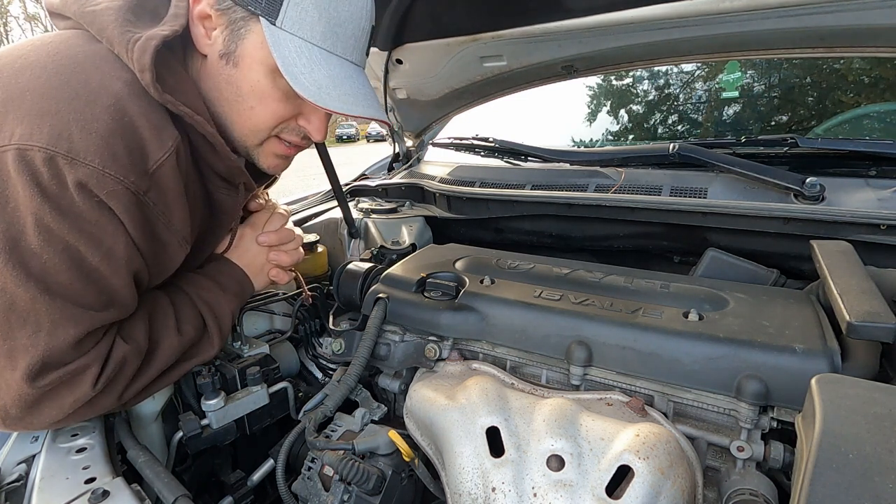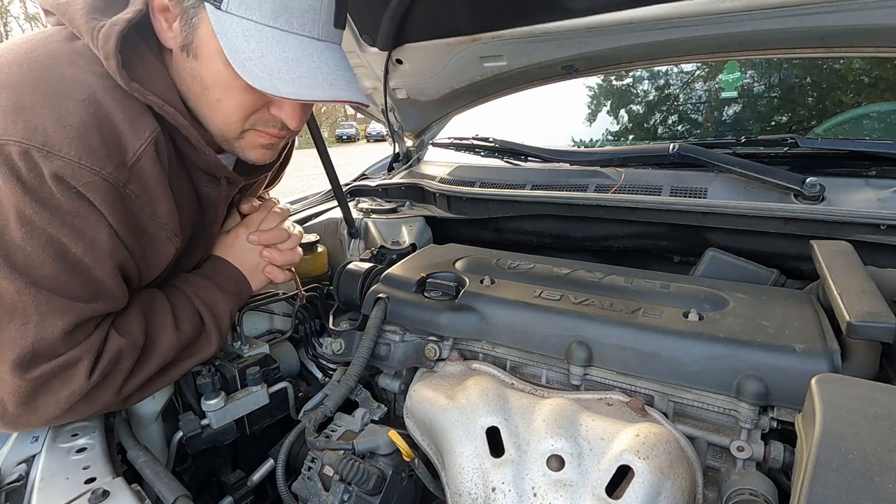So what we're going to do today is we're just going to replace it. I'm going to see if I can locate the crack and take a look at possibly why these things crack. I'm not going to sit here and badmouth Toyota, but is it possible that they had a design flaw — that this manifold is so massively heavy that the sheer vibration of the engine cracks these manifolds? That's my speculation. So how do we correct that? I think it's a design flaw, so why don't we redesign it and get a lightweight manifold.